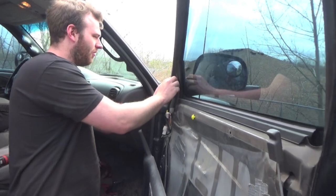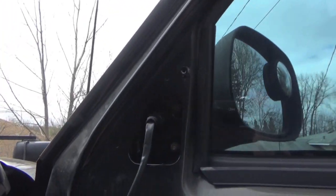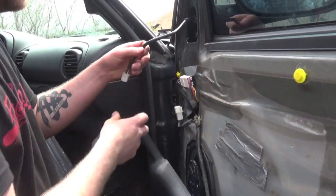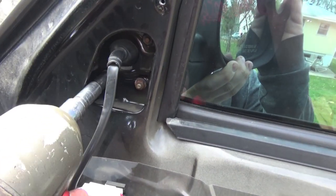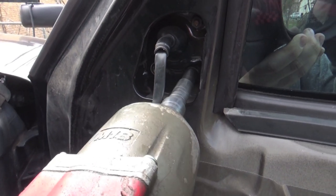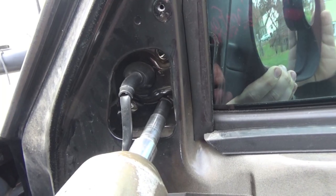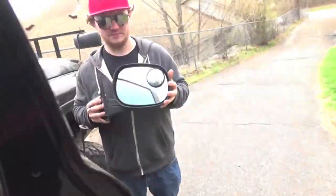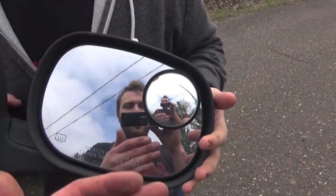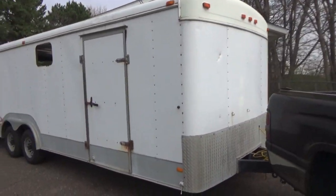Now we got access to our mirror itself. We'll remove this foam bit right here, and then we'll have some 10-mil bolts right there. The electrical connector is chilling right here — just squeeze and pull that off. Then my lovely assistant will stand over there to hold the mirror while we take it off, and we'll whip these three 10-millimeter screws out. Then we'll pry this electrical boot out, and we got the actual OEM stock Dodge mirror. The only thing that was saving us was the round part on the mirror and sticking our heads out the window so we could see past this gigantic behemoth of an enclosed trailer.